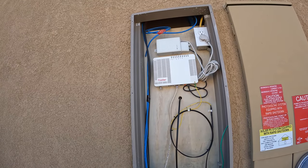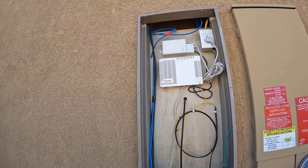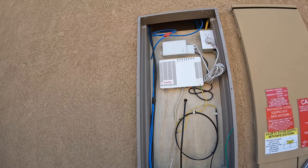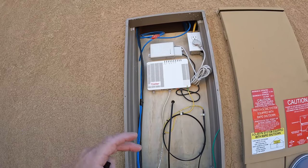I have a Wi-Fi 6 router with external antennas that does MIMO beamforming, so the direction the network device is located is the direction the signal is sent to. You just get better RF performance.